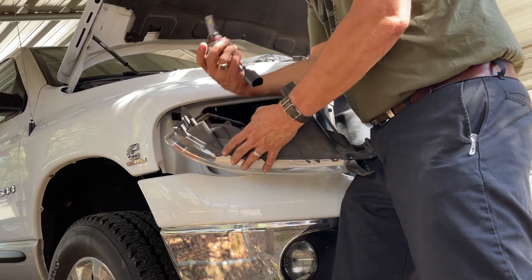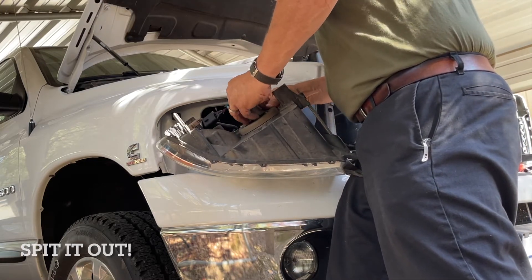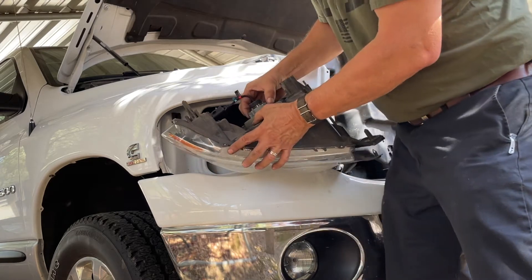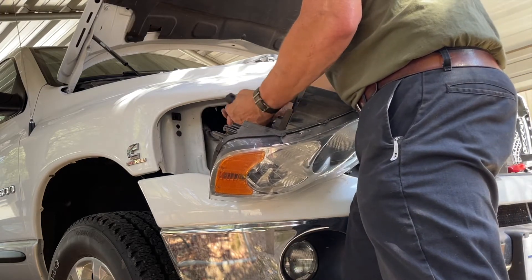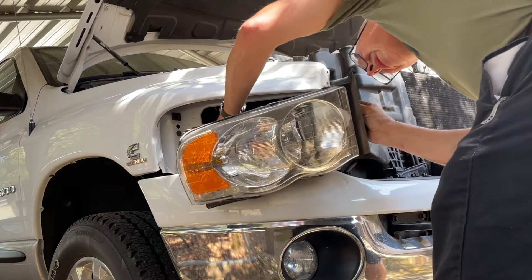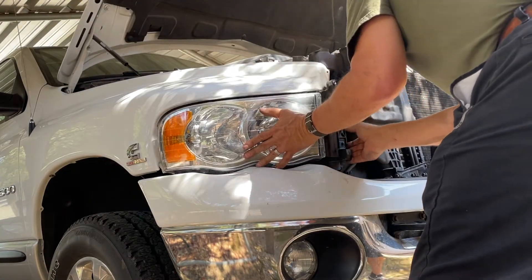Anyway, back to the story — you don't want to touch the bulb part because it'll make a hot spot, and hot spots will make your bulb burn out. That's not good. It just plugs in just like the old one, but it just has a little cord on it. Plug it in, just reverse the process. Make sure nothing's in the way, the wires make a good shape. Just push the unit back in, make sure you line it up — there's a dowel, front and back.